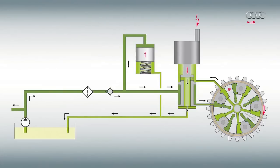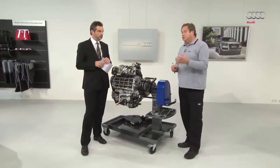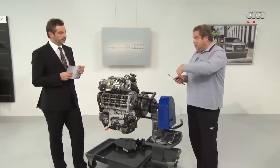We have another graphic. Now the valve is supplied from above. The adjustment should now move to the late position. It is always at early and the camshaft adjustment moves to the late position. The solenoid valve is energized. The accumulator supports the camshaft adjustment, so it quickly moves to the late position. In the same way, the accumulator supports the movement to the early position.